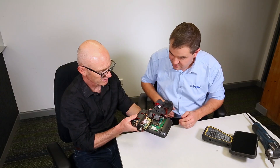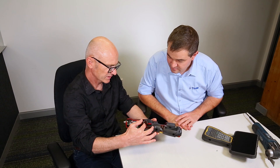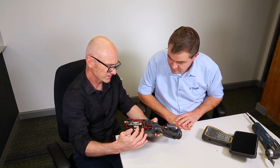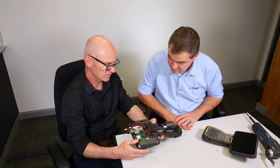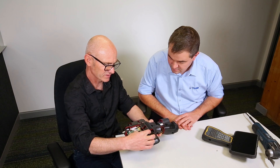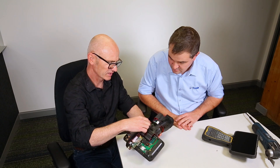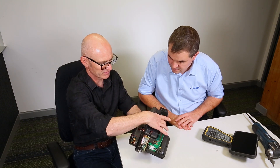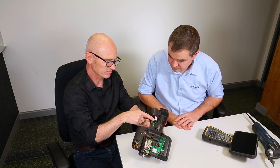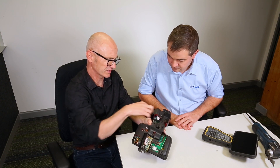So what is this copper stuff doing? The CPU obviously gets rather hot in the field, so the way of getting rid of some of the heat is to take it away from the CPU to an area where it's not so hot. We're basically using a copper heat pipe which takes the heat away from the top of the processor down to what we call the neck area, to an aluminium heat sink area.